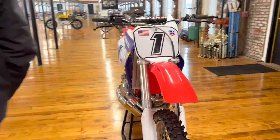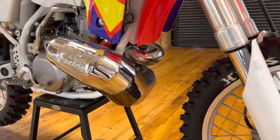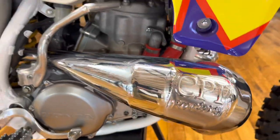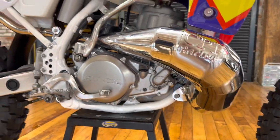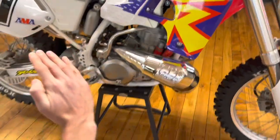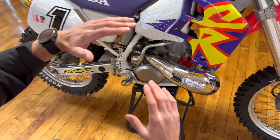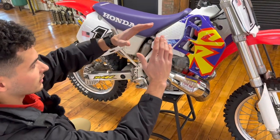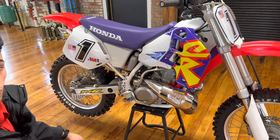Come back on this side — this is a massive displacement CPI pipe; these are made out west as well. In our experience dyno tuning these, you go from a stock pipe up to the bigger displacement pipes and essentially with the bigger expansion chamber, you're going to move the power curve. Let's say you're peaking out at 6,500 RPM — with the bigger displacement pipe you're going to push back that peak horsepower and actually have more peak horsepower.